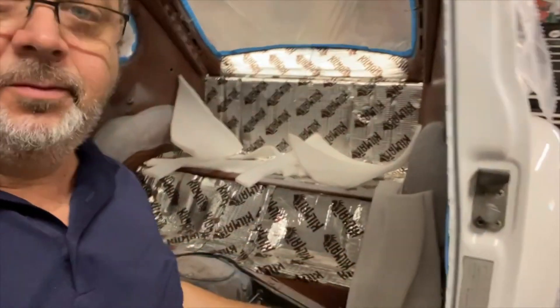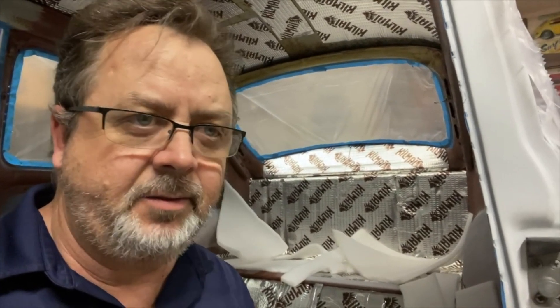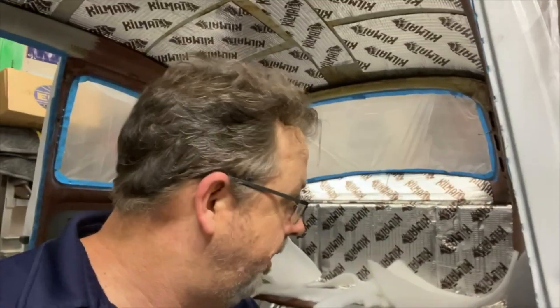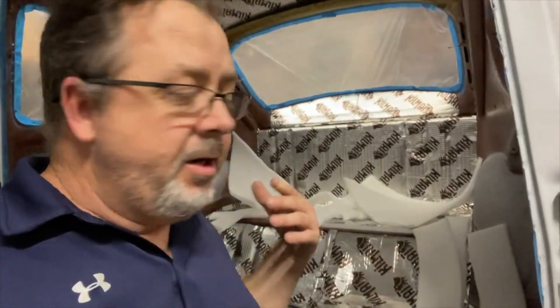Got everything - the windows all taped up so I don't spray glue everywhere. I've been looking at the J Bugs video - seems like the most straightforward one on installing these headliners. I had to make my own kit because this was kind of a freebie headliner a friend had from a swap meet. It didn't have any foam kit so I went down and got a roll of half-inch foam at Walmart - just enough to cut out the 11 pieces needed to do the foam behind the headliner.